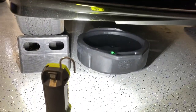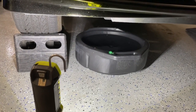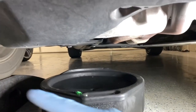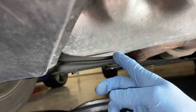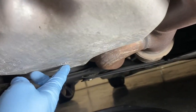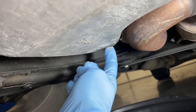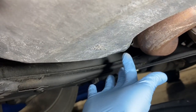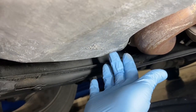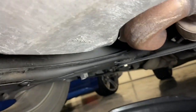Here we are at the front of the car. I've got the oil pan slid underneath and my light here. I'm gonna show you where the drain plug is — you take it off with the 17 millimeter. This is the passenger side tire; you come just straight back. You can see the oil pan here, and it even says 'engine oil' on it, so you can't make a mistake. The nice thing with the plug being on the back of the pan is when you put it on ramps or jack up the front, you're gonna get all the oil out because it's on a slope.